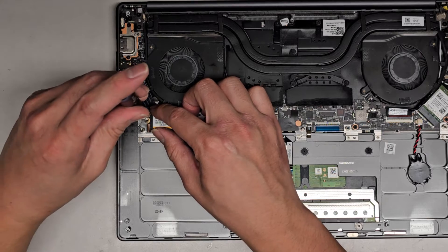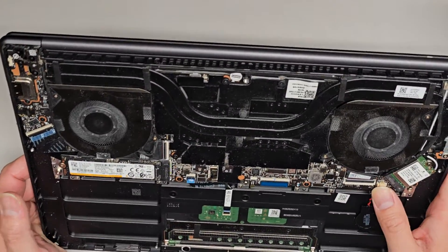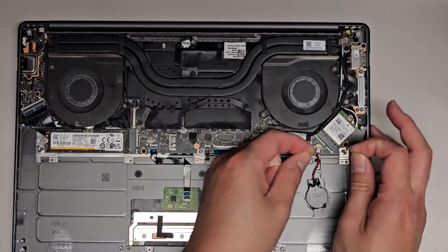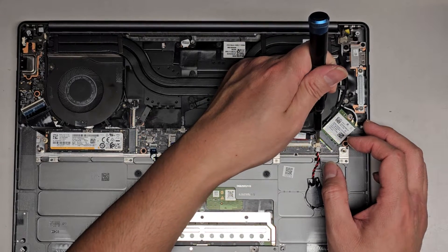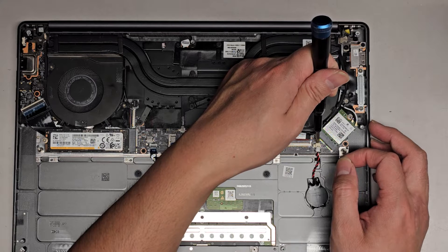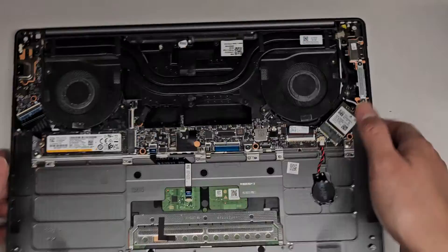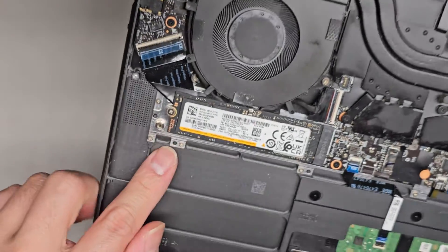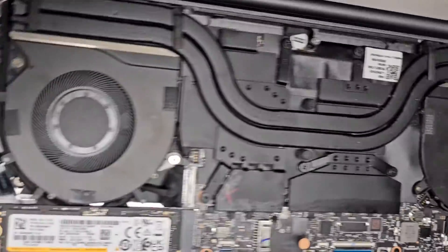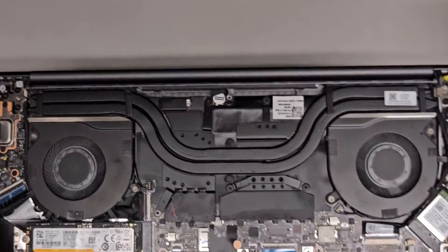I'm going to put this back together and clean the dust off of it, then reassemble and hopefully they have some luck with it waking up. Maybe to be safe, I'm going to disconnect the CMOS BIOS battery as well. Sometimes I'm going to short the two pins here — draining that might fix it if it's a weird BIOS issue. My customer is waiting outside so I need to be somewhat quick. The keyboard looks like it is removable — there are screws holding this metal plate on top of the keyboard, but you do need to take everything completely out, so it's a real hassle. I'm going to clean the dust out and I'll be back.